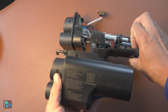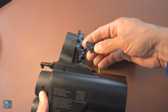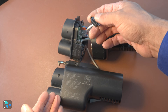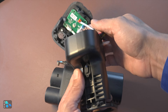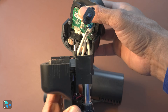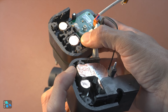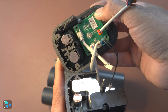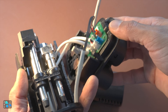Let's go through the various components. We have removed the entire top portion of the connector so you can see what's going on. The first thing you'll notice is a little switch right here — this switch corresponds to this latch right here. This is one of those safety mechanisms so the vehicle and charger know you're trying to remove the adapter. You should always stop the charge first, but you can actually just hit either of the latches. Inside there are also some other critical components — check out those DC pins. Those are really big chunky DC pins, silver-plated copper, and that's why this connector is as heavy as it is. We also have what appears to be a little circuit board, but actually there's no logic contained in there — there are just a few resistors, and other than that it's just a place to connect all the various things going on inside.